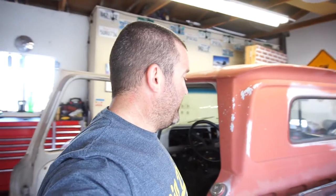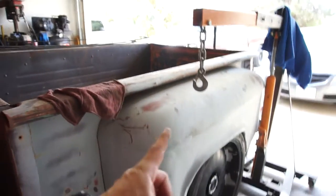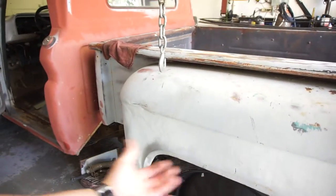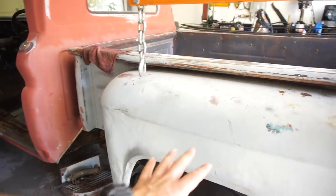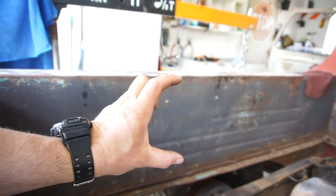My main project — and you guys let me know — is that the wheels and tires are rubbing. I've got two options. Option A: get a wheel rolling kit and roll the inside of this fender to make clearance for the wheel. Either way I'm going to have to tub it — do a little mini tub, probably like a six or eight inch tub, maybe four inches over, so the wheel can articulate in there.